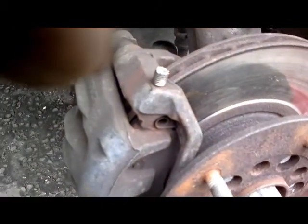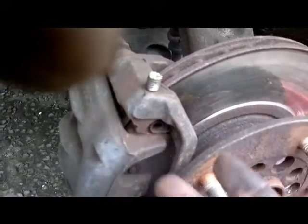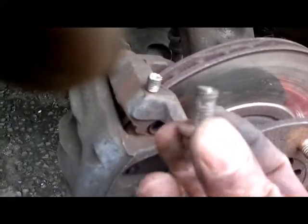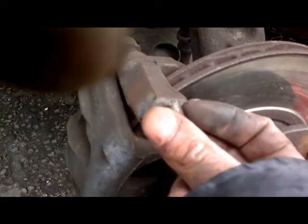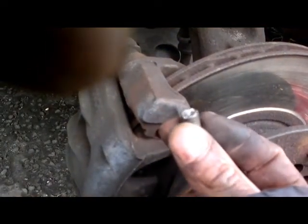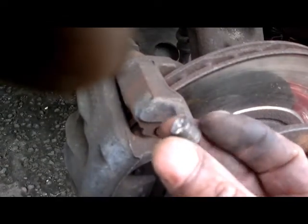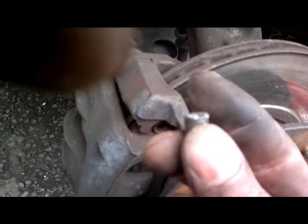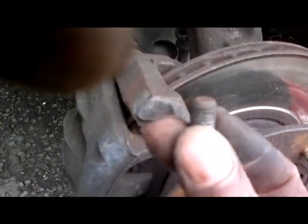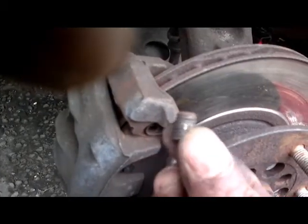Now I've got that stud there. That's the broken bit that I had to get out. I had two of them to get out. That's the bit that it's broken off from. Now I've been drilling for 45 minutes, and if you look at that, I've just made a little indentation in there. So probably needed a hardened drill bit to really cut through this. But if I've done that much in 45 minutes, how long would it have taken me to get through that? Two of them. Now I'm trying to get you to think the way I do.